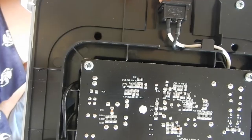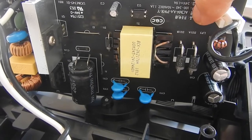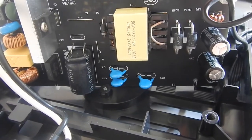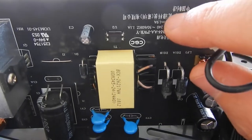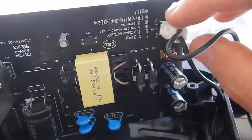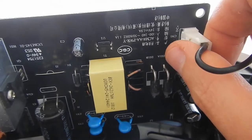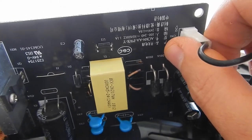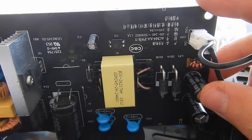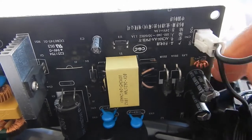Here is the circuit board at 200-plus volts. As you can see, it runs on 100 to 240 volts AC input and outputs 24 volts DC at 1.9 amps. Since it's 24 volts DC and I have the DC minus and DC plus from this board, I can connect a switch to DC current and everything should be fine. Or I could go directly to the ventilator and just power the ventilator, or plug in 24-volt DC and everything is good to go.